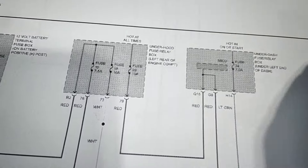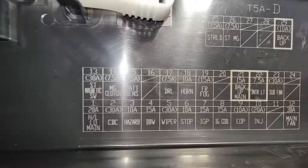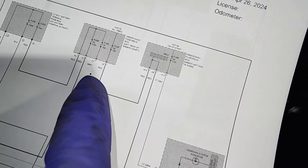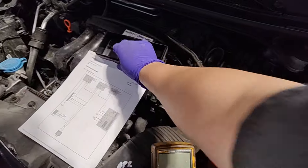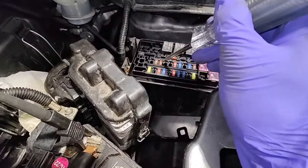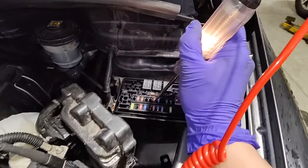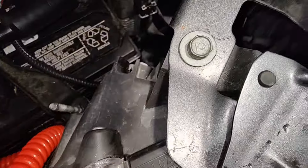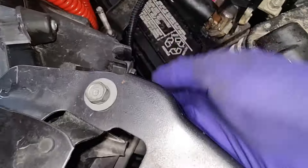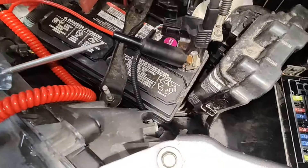So fuse 15 - and I believe that blurry number is 18. Fuse 15 is battery sensor at seven and a half amps, and then fuse 18 which is weird is a horn fuse, but in the wiring diagram there is a splice so that fuse feeds more than one thing. I can just push the horn and the horn works, or you can grab your test light and check it - make sure you've got power on both sides of that fuse. There's a 10 amp right there, but that's good. The other thing you can check is at the connector - see if you have a broken wire, maybe someone didn't put the sensor back properly, because you can see it's just dangling there. Maybe it rubbed through somewhere. Someone didn't install this thing properly and could possibly have a broken wire.